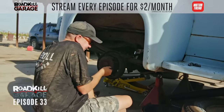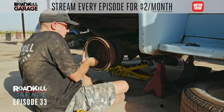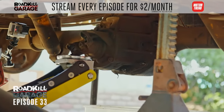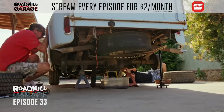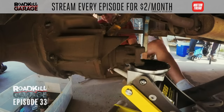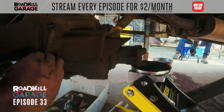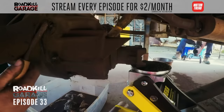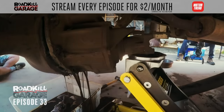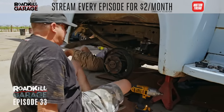When stuff is broken bad like that it's hard to turn the axle to line up the bolts — doing the old brake-drum axle-puller tech. Someone RTV'd this thing on — you might have to smack it. Really stuck. Part of the problem is that copper washers are on every single nut holding it on, which captures everything so the center section won't come out. There it goes — naturally most of it hit the ground, but we'll finish it up.